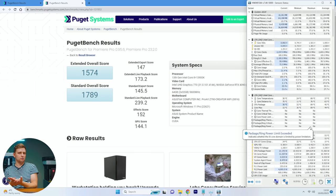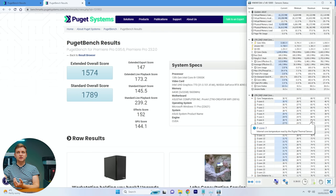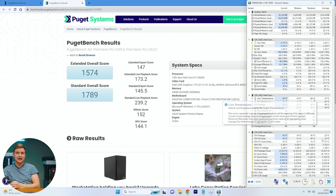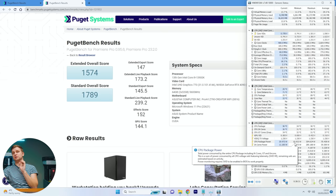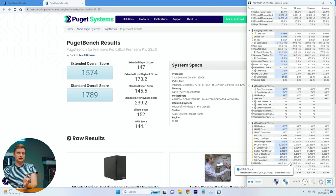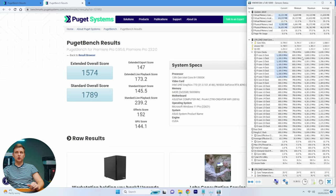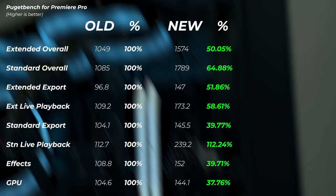During the benchmark I ran HWiNFO in the background. The maximum core temperature was 89°C, and the CPU package temperature — which reads the highest sensor — hit 90°C. We pulled a maximum of 304 watts, which is ridiculous, but the minimum was just 10.9 watts. Right now just browsing, it's pulling around 17-23 watts — super efficient. Clock speeds peaked at 5.8 GHz on two cores, 5.5 GHz on six P-cores, and 4.3 GHz on the E-cores.